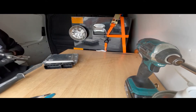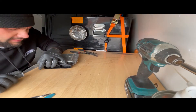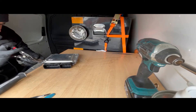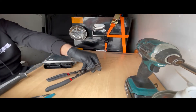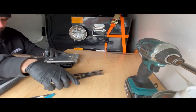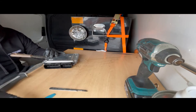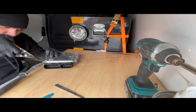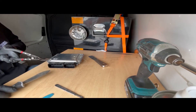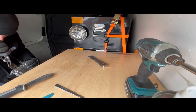So once we're in here, what I like to do is just place the bits carefully — we don't want to damage the components. As you can see, there are some bits of glue that you've missed. And then once this tool's in, we've got a good grasp of that ECU lid. From here I like to get it into the lamp so I can see what's going on.